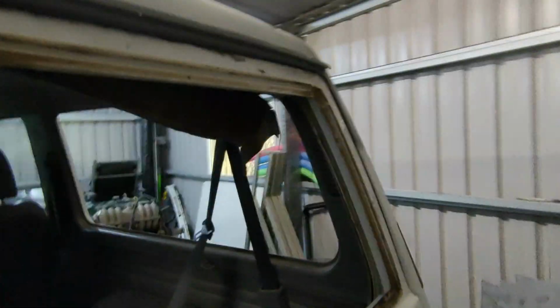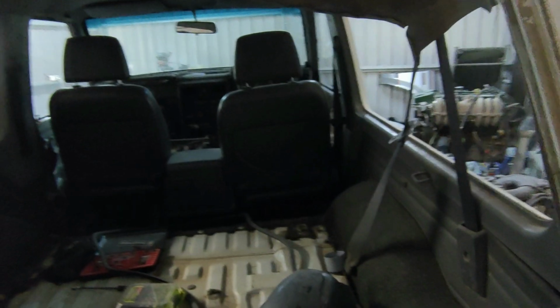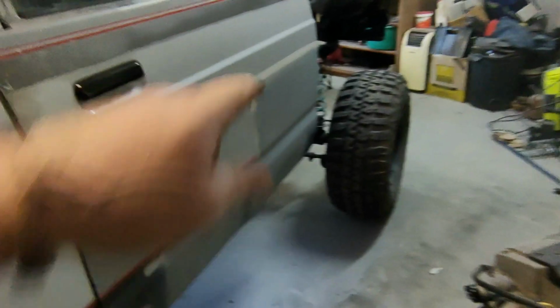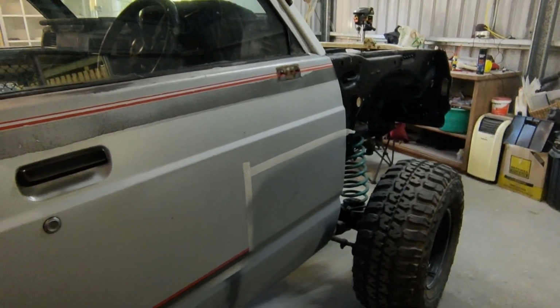Obviously, painted the guards. We got that one still needed a bit, so we've undercoated everything else, ready to get some guide coat on there, so I can guide coat everything. Got one window out, got this one out the fast way, ejected it. Still bleeding from that sucker too. So that's primed. Obviously the doors. This one reacted a bit, so I don't know what the go is there, so I'm just going to sand that back again and start again. That rust repair up there is done.